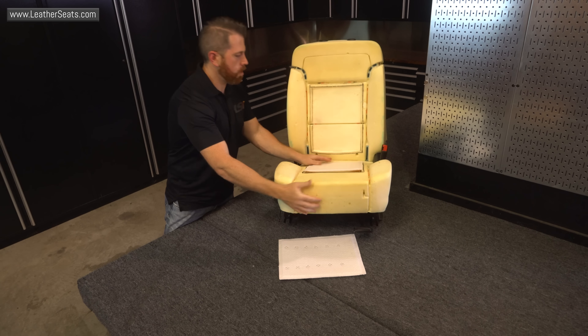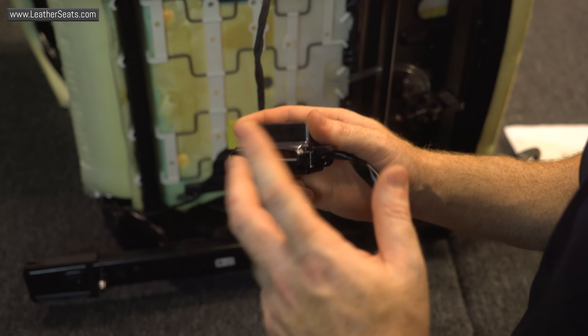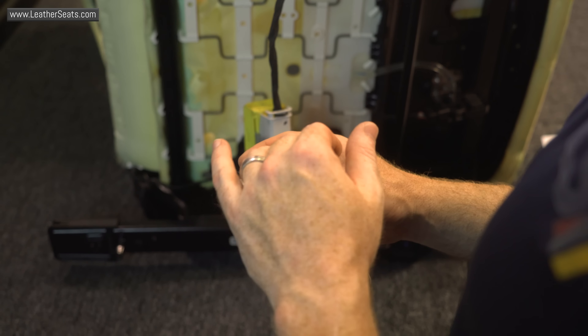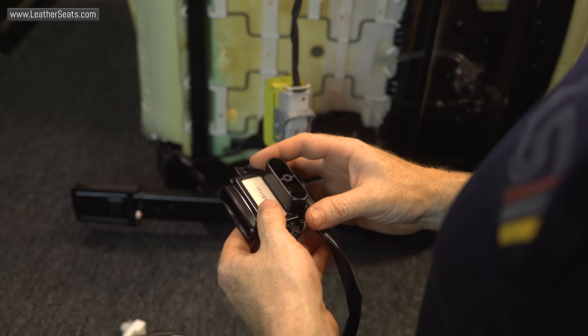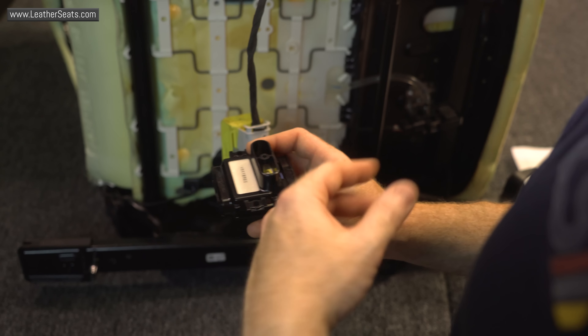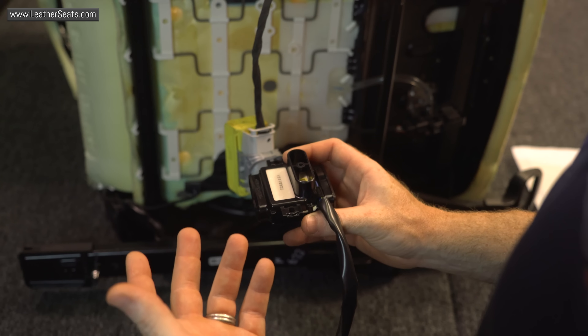I've got one of the two TED devices that's included with our kit. TED actually stands for thermoelectric device. There's a bunch of other names for this device, including a thermoelectric cooler or a thermoelectric heat pump, but basically they all operate on the same principle, which is leveraging the Peltier effect. Inside the TED, you have two semiconductors that are separated by two junctions. When we run a 12-volt electrical current through the semiconductors, one of the junctions naturally begins to pull heat from the other junction, which creates a heat differential. When we start to blow air from the centrifugal blower through the intake side, whenever the current is run one way, you have hot coming out of one exhaust port and cool coming out of the other. When we flip the current, you get cool out of one port and hot air exhausted from the other.